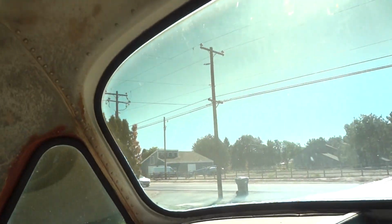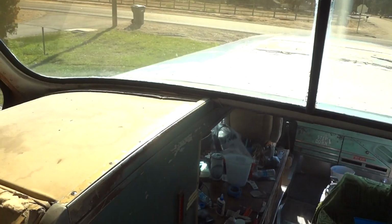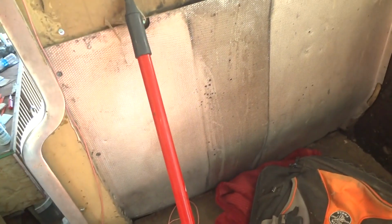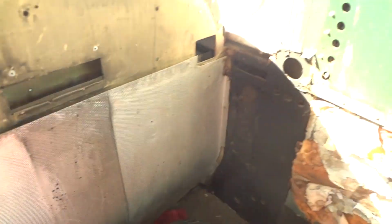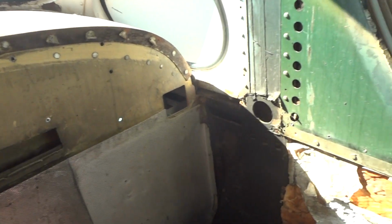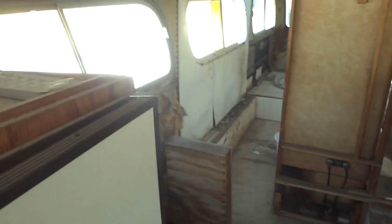And right here, look, there's the supply to the defroster. There's a bunch of holes up here. So you defeat these fans and you no longer have defrosting capabilities, and your heating capabilities are real slack. You probably have a propane heater and a bottle of gas that may, under certain conditions, fill the bus up and explode. I don't want volatile fuel, no gasoline, nothing on here. This is diesel electric all the way.